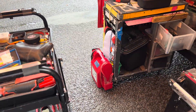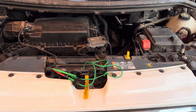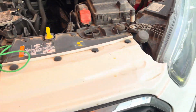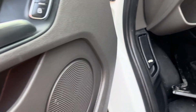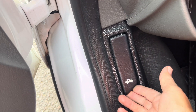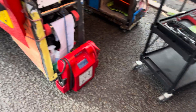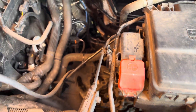Just a little top tip: if you have a Ford Transit — this one is a 20-plate — you cannot open the bonnet from the front anymore. You have to use the little handle, which is on the passenger side. The problem is, when your battery is flat, that door won't open, so you can't open the bonnet to get to the jump start point. It's a stupid design, so here's how to get around it.